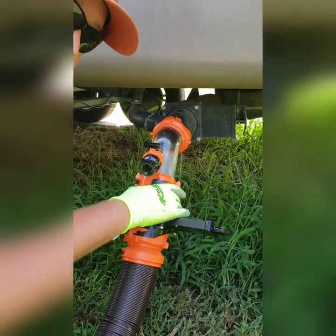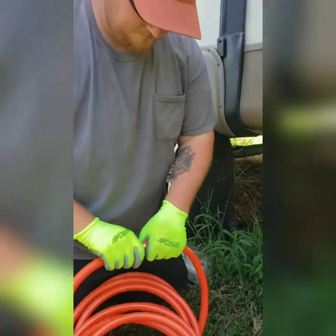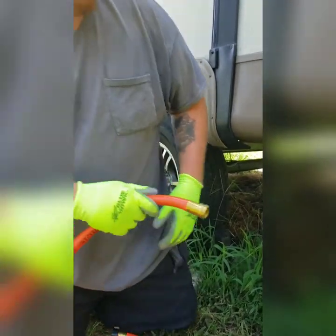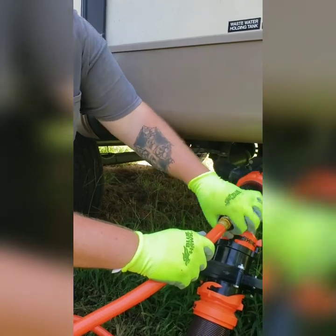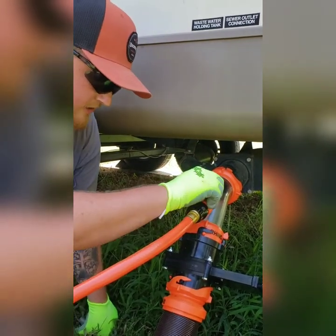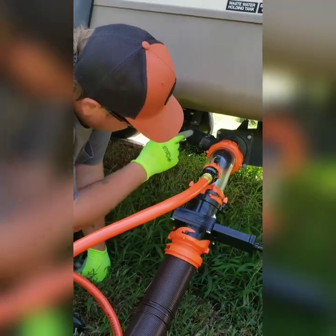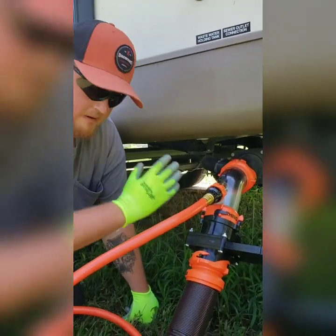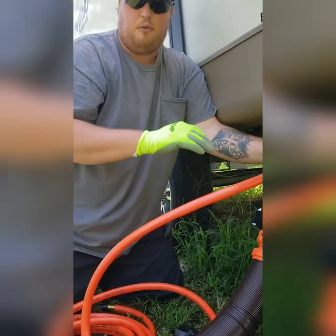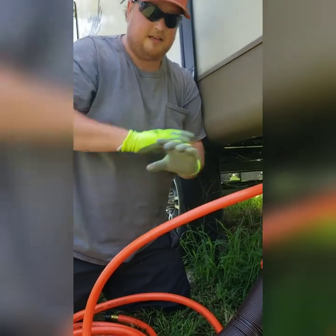To make things in your black water tank more bearable, you have your specific black water rinsing hose. At every clean-out station I've been to, they've already had a water spigot there. You hook this up into there, turn the water on, turn this valve on, and it shoots water up in here with the other valve closed. It shoots all the way up into your black water tank and cleans out a bunch of the toilet paper and muck in there. On this specific camper, we do have a black water sprinkler system on the other end — you can hook this same hose up and it turns sprinkler heads on inside to clean everything out as well.